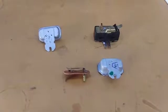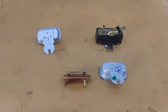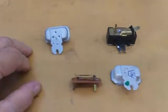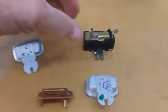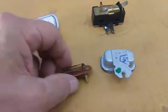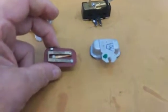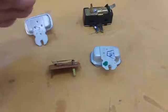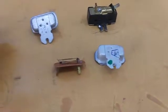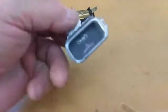The last piece we're going to talk about is the actual vibrator. There's a lot of misnomer on the forums — these metal ones and the plastic ones are really a regulator. How the vibrator works is interesting: it has a wire wound element that gets heated up with the current running through it, which bends the bi-metal and opens and closes the contacts fairly quickly — three or four times a second. The average output is about 5.1 volts, and that's what it looks like in its container with the two contacts.